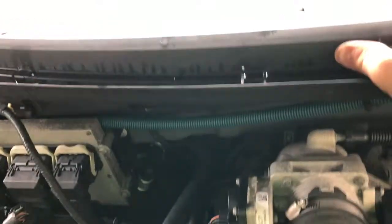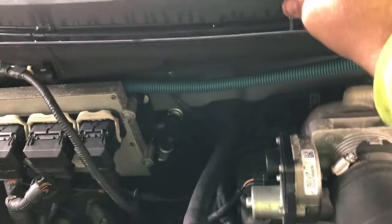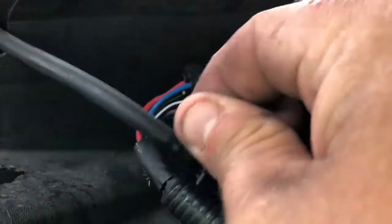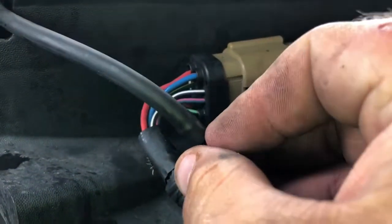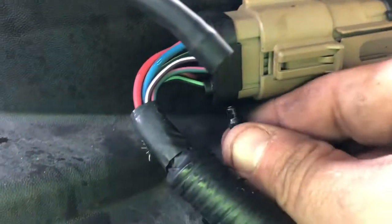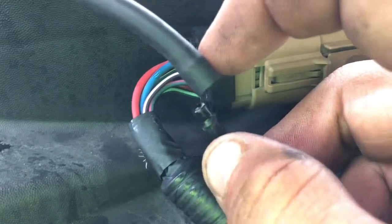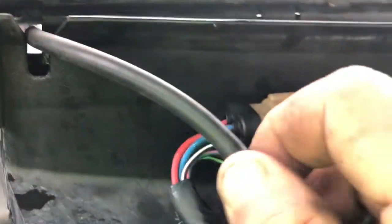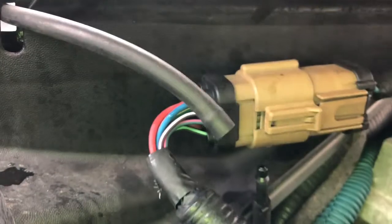On this side it's not much different than the other side - you just kind of push these little tabs. Before you take this off completely, make sure you come down here to your washer fluid line and pop it off. One way to make these easier is to kind of twist this top part back and forth to break the seal initially off of here, so it's a little easier to pull off. Once you twist that off it should be pretty easy. You can see it's kind of barbed so it pulls off, and the replacement should come with a new tube to hook back in here.